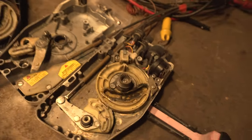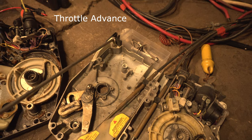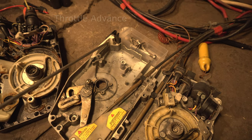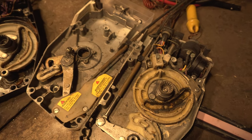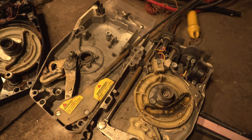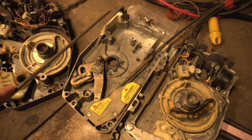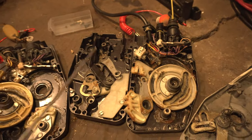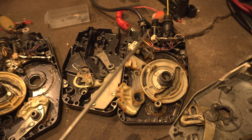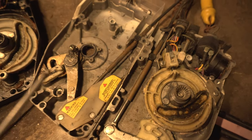The most common issues I've seen so far: one is when the choke lever — the lever that allows you to start the motor more easily — does not work. Another issue is sometimes when I tried to start the motor I would have to fiddle with the handle and move it back and forth, and then the motor would start, as if the control was not allowing the motor to start, maybe thinking it was not in neutral. The third problem was this lever simply did nothing — it would lift up very easily all the way to the top and do nothing.